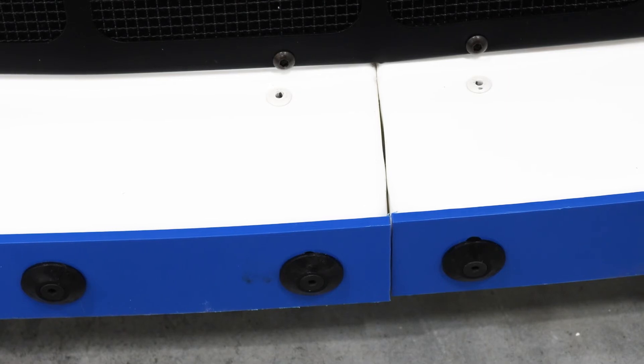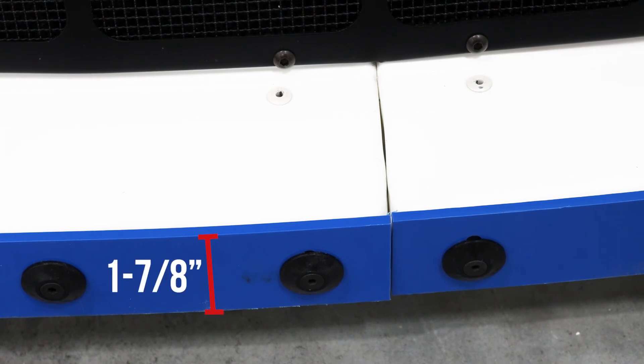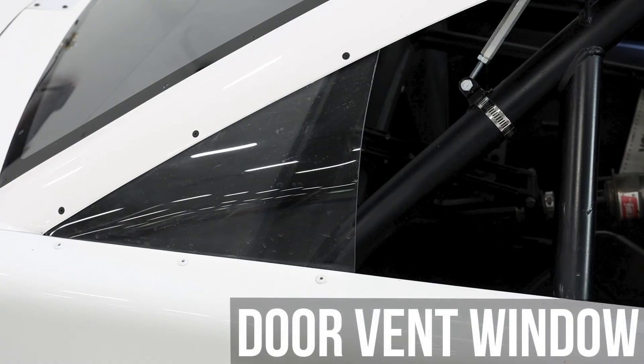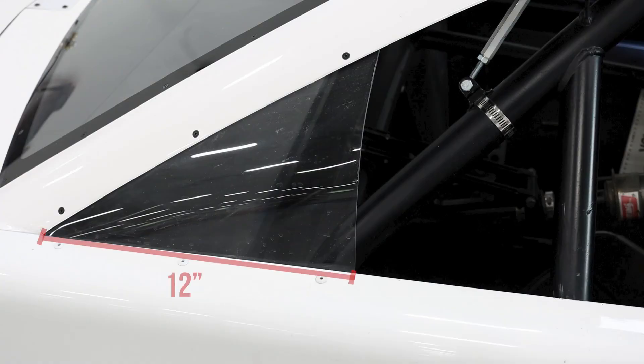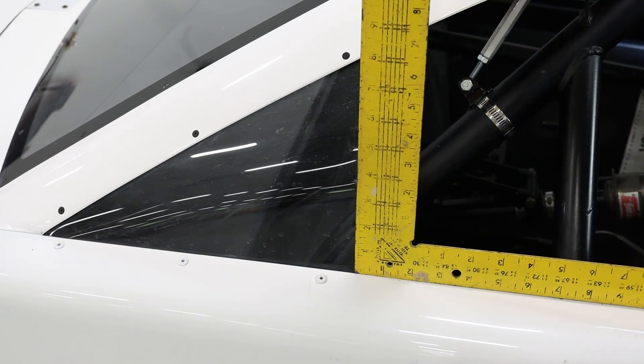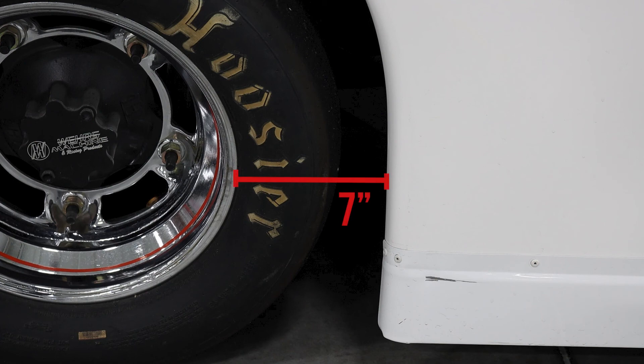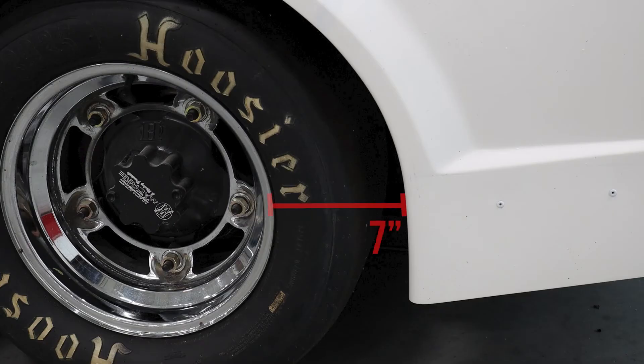In the event the lower part of the nose has been worn down, a wear strip may be placed on the nose. The part will be made from plastic only and must measure a maximum of 1 and 7/8 inches tall. The wear strip must be mounted in the same plane as the original front valence. The maximum dimension for the vent window along the top of the door is 12 inches, and the window must go 90 degrees from the top of the door up to the B post. The nose and quarter panels are manufactured with a finished wheel opening and must not be altered in any way. Wheel openings may not be larger than 7 inches from the edge of the wheel at the front and rear of the opening.